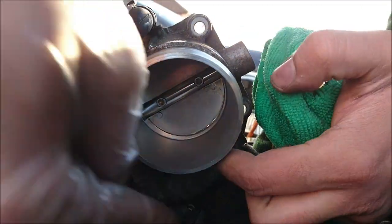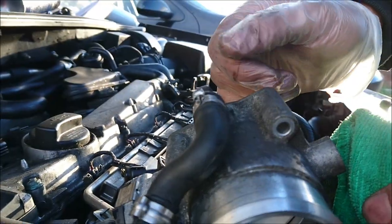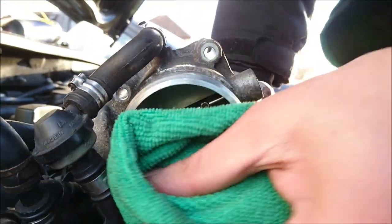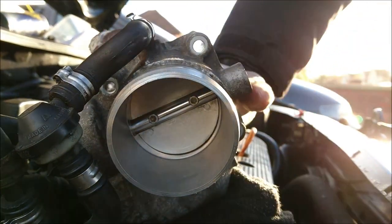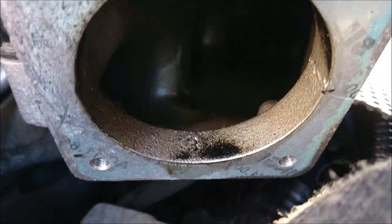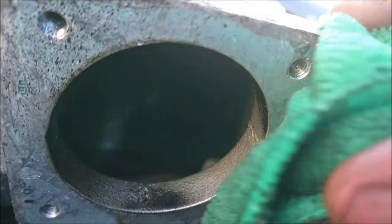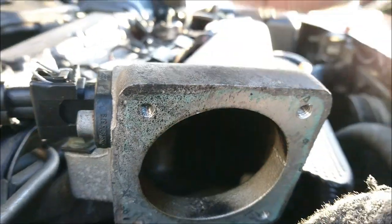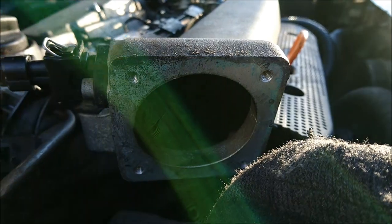Because we've left the sensor over here and the breather hose on, we don't need to connect those two things back. And because we left that sensor on we're not having to recalibrate anything either. While we've got this off we're just going to inspect the inlet manifold — it's nice and clean just as you'd expect. Just going to wipe off this little bit on the mouth of it, but really nothing out of the ordinary in there. Everything's good, so I'm not going to bother opening that all up and cleaning it because it's a petrol car, not a diesel car.